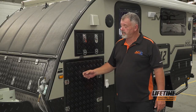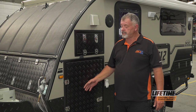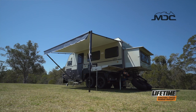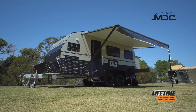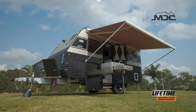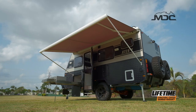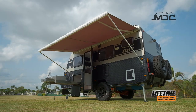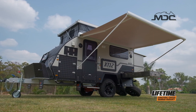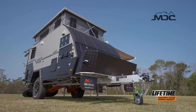Take for instance checker plate. Now being a painted finish, paint will oxidise over time. So what you need to do, like you would with your car or anything else, you need to wax your van fairly regularly, including the paintwork. By using good quality wax — a carnauba or something like that — you'll extend the life of these finishes and reduce oxidisation, and your caravan will look better for much longer.